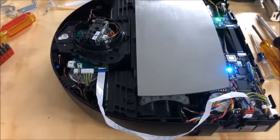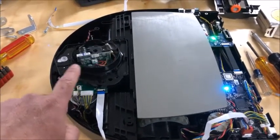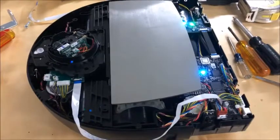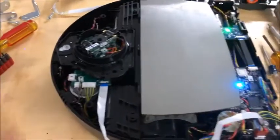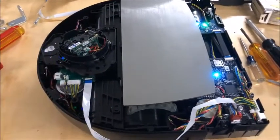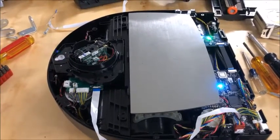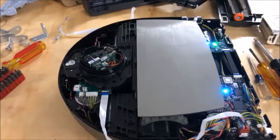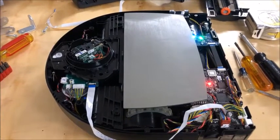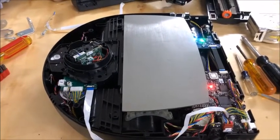As you can see, it just stopped — it's going to try again. Basically what it wants to do is spin the LiDAR to see where it's at, but nothing's happening. It's not even moving out of the base. I know for a fact that this has to be spinning in order for it to recognize where it's at and what the environment looks like. If you have any ideas, let me know. I will follow up after I hear back from Anito as to what to do. Thanks — bye.